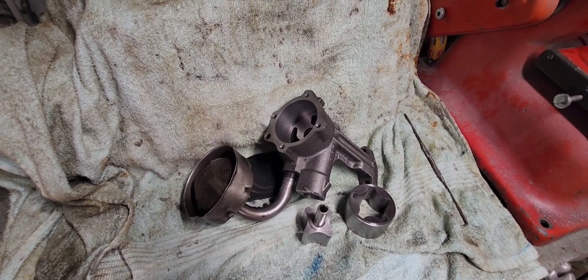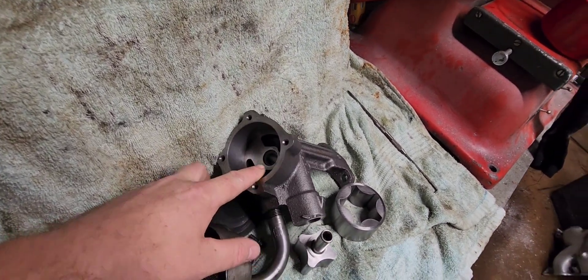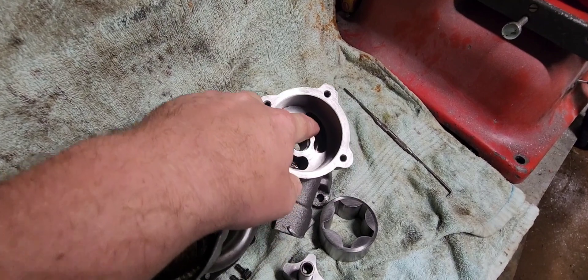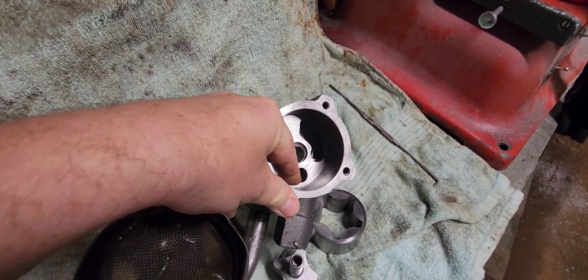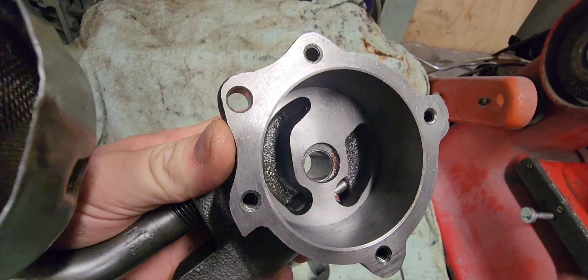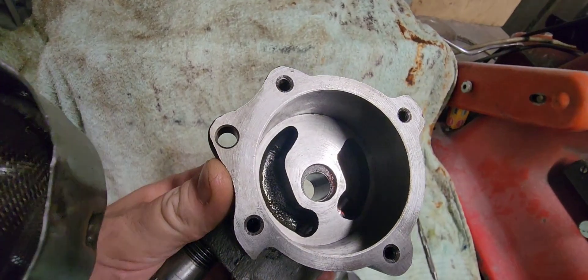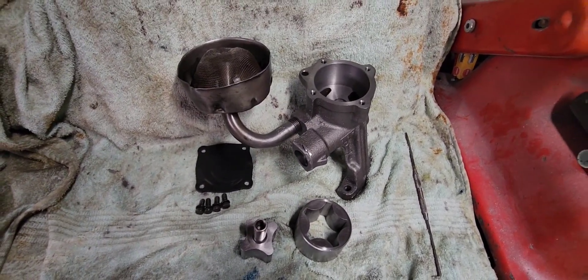Hopefully that's enough for today. It'll give you a reason why, if you're going to do porting, smoothing, and radiusing anything to do with a pump, always do the passive — suction — side of the pump. Don't worry too much about the pressure side, but focus on the passive side and also around where it returns — down in there. There's the pin and there's the return. Focus on those areas to help assist oil flow coming back into the passive side of the pump. Thanks for watching — we'll see you next time.